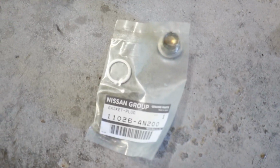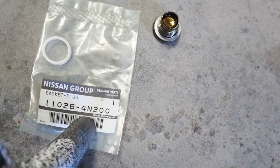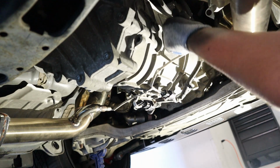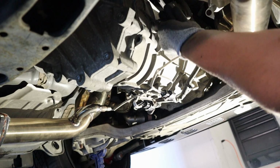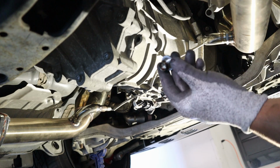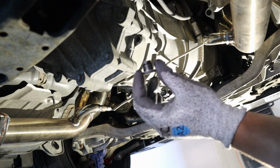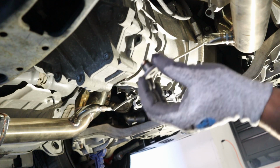As you guys have seen in previous videos from my diff service, there is the drain plug I just took out, and here's the washer that replaces it. There's the part number. I'll also have the number in the description. All right, guys, now that I've put the drain plug back in, I'm just going to take out the fill plug. Ideally, you would want to replace both of those crush washers, gasket seals, whatever you want to call them. I only had one left, so I only replaced the most essential one, which is the drain plug. I may down the line replace another one, but it looks like it's still pretty much brand new. Nonetheless, the FSM still requires you to replace it.